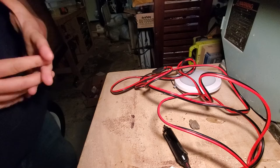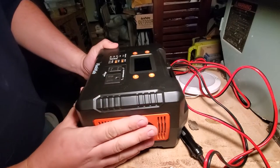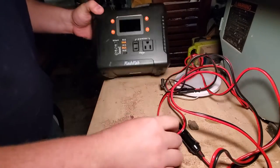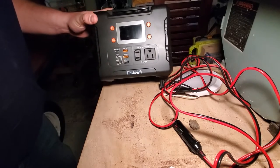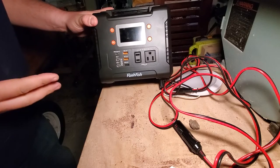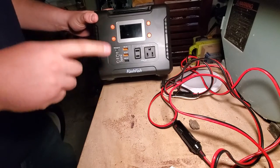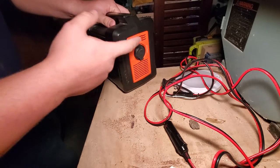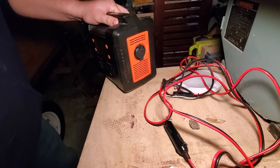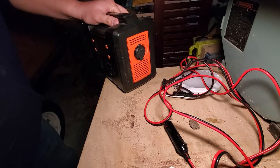I don't know if you remember what my plan is going to be for electrical. For the most part, I just plan on powering everything using some sort of battery. This is the Flashfish — I'm not sponsored, just this is what I bought because this was the cheapest. I eventually do plan on maybe getting a Jackery or one of the bigger brands. In any case, the plan is to run a cable to an SAE port that's going to be on the trailer. That's going to run a 10 gauge wire up to the fuse panel, which is going to distribute all the power to all the individual ports and lights and so forth that I have up in the trailer itself.